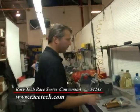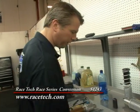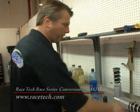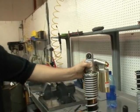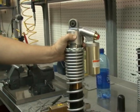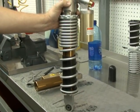What we have is one of the more popular current ATV models. I think this thing will really take off shortly — the Yamaha YFZ450R. This is a stock component right here. There's been a progression on the ATV side as far as higher-end components coming stock. Some of the problems with stock ATV stuff typically is they tend to be a little bit undersprung and overdamped. It's all fixable — the shock isn't junk. If you modify it in the right places, it can work.